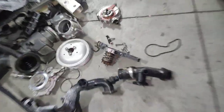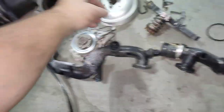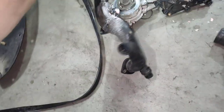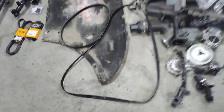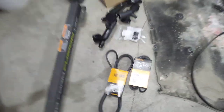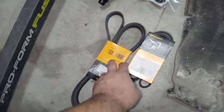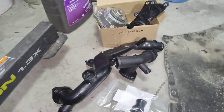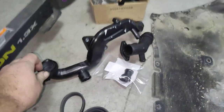Vacuum pump, obviously the supercharger has to come off — that one's right here. All leaky water pump, all leaky thermostat, all leaky crossover pipe — but the other half. Serpentine belt, supercharger belt. Here are the new ones: serpentine belt, supercharger belt, that's a union pipe between the supercharger and the breather, crossover pipe — the other half of the crossover pipe.